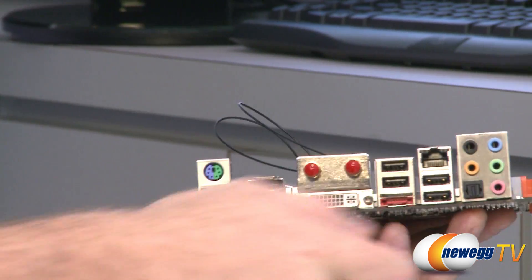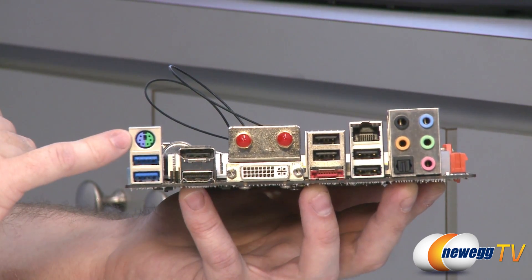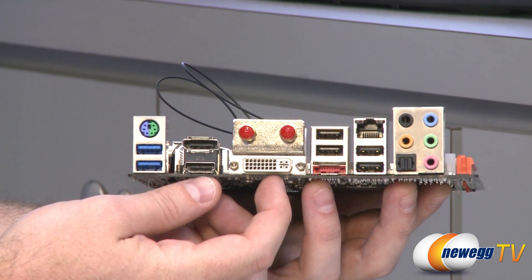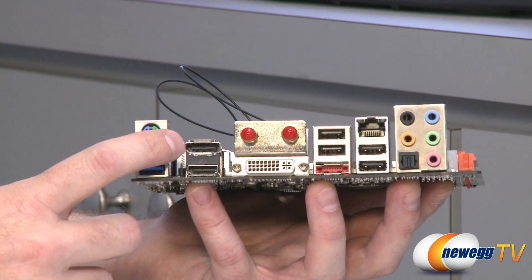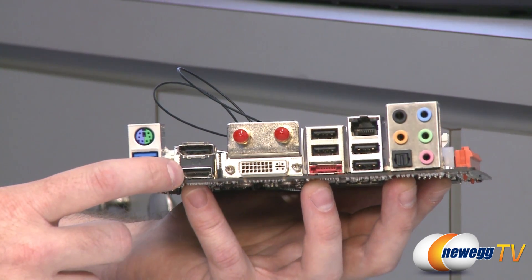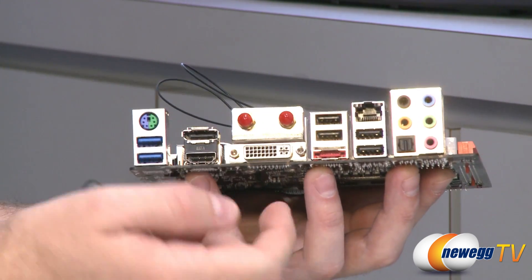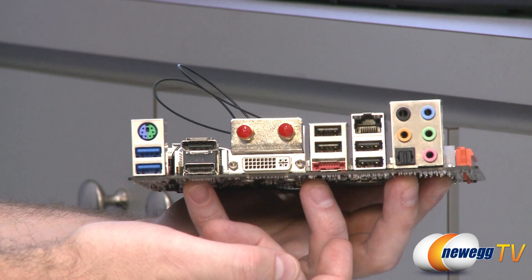Along with that, we have some built-in ports on the back of the board. Starting over here: two more USB 3.0 ports, a PS/2 port for a mouse or keyboard, and then your display outputs — controlled by your Intel second generation Sandy Bridge processor. The H67 chipset does allow for overclocking of the integrated GPU. You have a DisplayPort right there supporting a maximum resolution of 2560 by 1600. Right below that is an HDMI port that can do up to 1920 by 1200. You also have a digital DVI port. Down here you have an additional eSATA port, which is a Serial ATA Revision 2, 3-gigabit port.